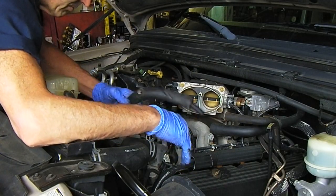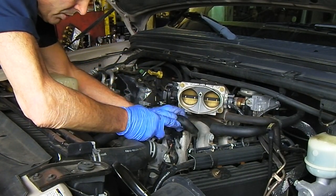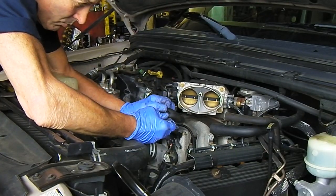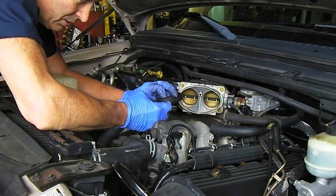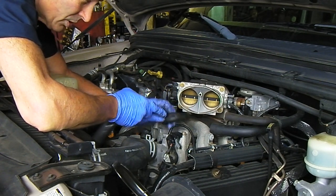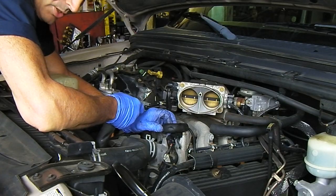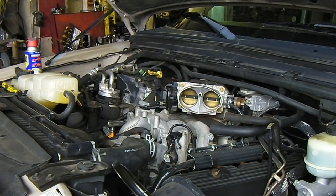The main point of this was that the truck came in with codes P0171 and P0174, caused by this PCV hose deteriorating and causing a vacuum leak — and that's what caused the codes. The tune-up is a maintenance item, and I'll take care of this PCV hose during that process. Sorry if this was a little too much inside baseball, but I thought it'd be interesting since I get so many emails from people about these spark plugs and about those codes P0171 and P0174.